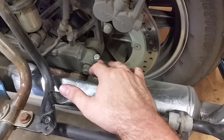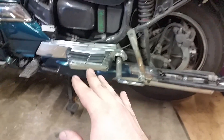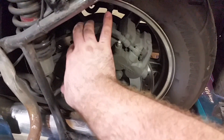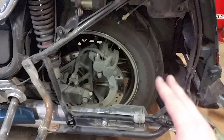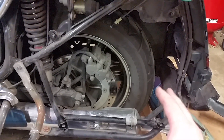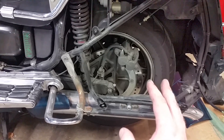You'll have to push the piston back in, then put everything back together. For those taking the tire off, you'll have to take off the other saddlebag and take this centerpiece off — it's not held on by much, just a few screws. I think the license plate bolts are part of the mounts too. You don't need to remove the trunk to take the rear tire off — you'll just need to loosen the safety nut and break the nut over there. Once you get it free you should be able to pull it out. Eventually when I get a chance I will do a video on that.